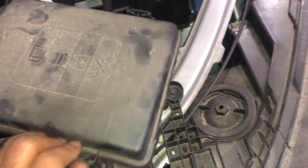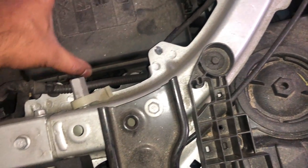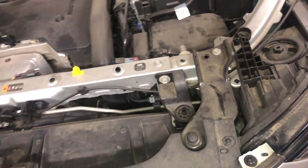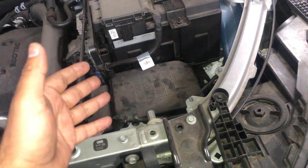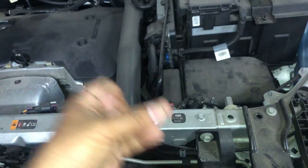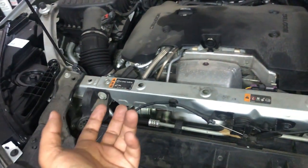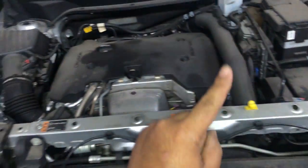Make sure you check your fuses — those fuses can blow over time. Let's say you're driving from Texas to California, that's a long ride, and you're going to blast the AC. That compressor is going to suck so much juice, and over time it's going to draw so much amperage it's going to blow your fuse. However, if the fuse keeps blowing over and over immediately, there's an issue — it could be a jammed AC compressor, the magnetic clutch is shorted out.